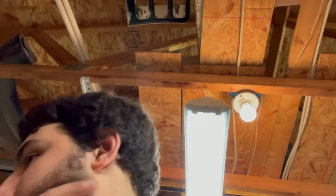I mostly did it just to see what I got to do to it, making sure my crosshatch pattern is still good and whatnot, and it looks really good. So I don't think I'm going to have to take it in to get machined. I do have to check the surface on the block, make sure it's not warped still, so I still have to do that, but everything looks okay. Kind of figured I'm going to have to replace all that anyway.